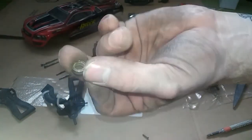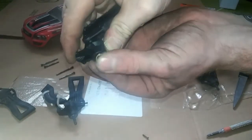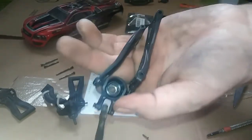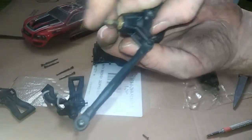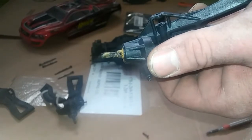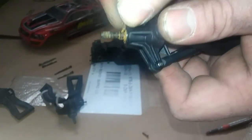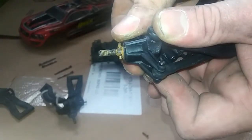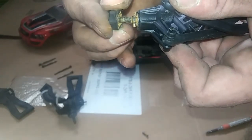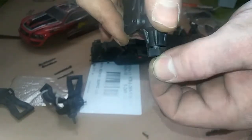I went ahead and removed that bearing from the outside of the old cup. I'm going to install it on the new one, and it should be just a perfect fit — it should just slide right in there. Look at that — nice and perfect. So we got this here, and boom, look at that. Perfect. Drop her in there. She's sitting nice and pretty. Push her through and you'll be good to go. Got the transmission cup seated in there nicely. Last thing to do: take your pin, line it up. You want to make sure it's somewhat even — pretty nice and even there. Lock one of those in. She's done. Spins nice.